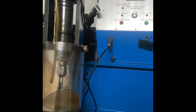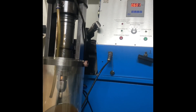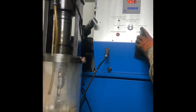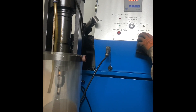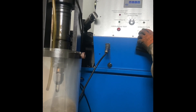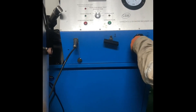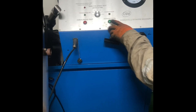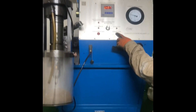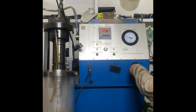To switch on this device, we have to turn on the power. The air valve also needs to be open. According to the manufacturer's instruction, set the pressure of the testing bench to 600 bar and wait one minute. You can check whether the pressure is dropping or not. If the pressure is not dropping, press the injection button. Make sure that the injection valve operates correctly.